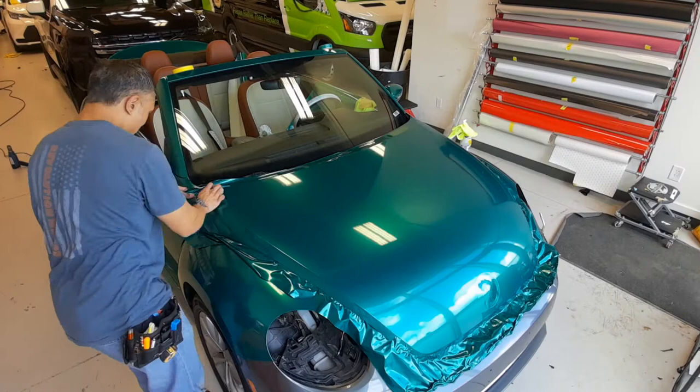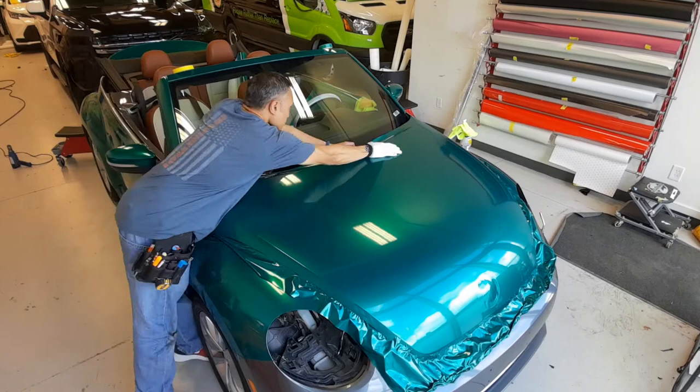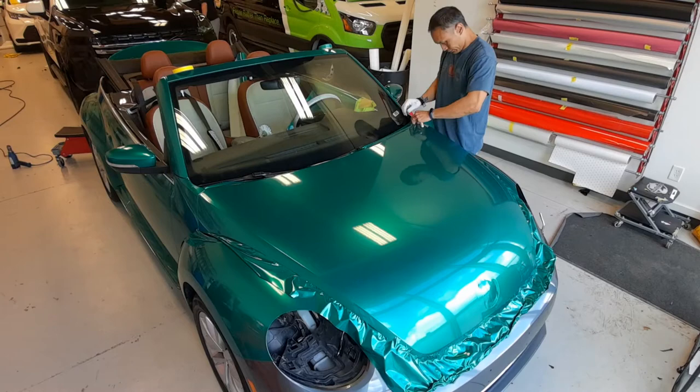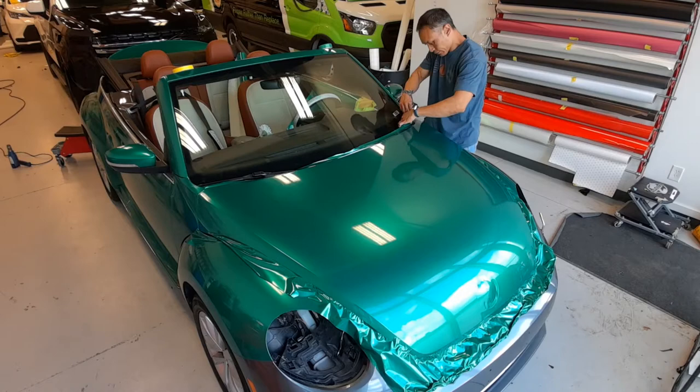I'm going to cut off some of this excess vinyl so that I can create my tab from the corner along the back edge of the hood. I'm going to go ahead and roll the back edge where the back side of the hood meets the windshield down a little bit in preparation for cutting it out. On that corner side you can see I'm doing essentially the same thing — cutting off the excess and prepping my step for the corner — and now I'm just cutting off the excess along the back side of the hood.